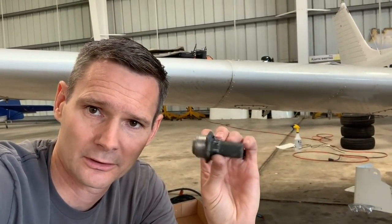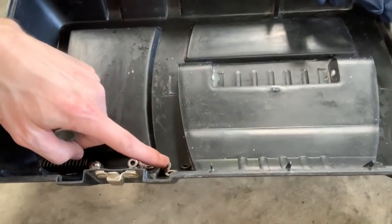So what I was going to do is take the oil pressure relief valve off and find out how many washers and which spring it had, and check the seat of the ball as well. I did find a little bit of not-prettiness in it, so we're going to clean that up and reset it. I found seven washers in there — it's only supposed to ever have up to five, so anything more than that and we need to relook at some stuff. The only other thing, which I really hope it's not, is the thermostatic bypass valve — that's a massive pain to get to because it's on the very middle of the back of the engine. We're going to fly it first and see if this fixes it before we dig into that.